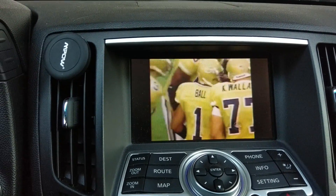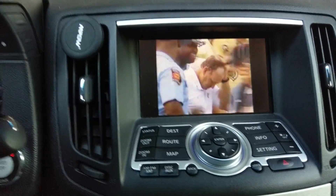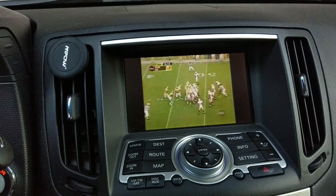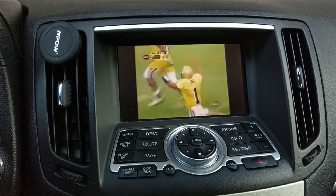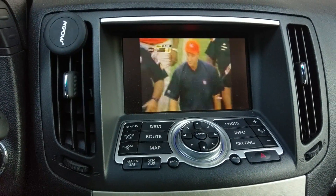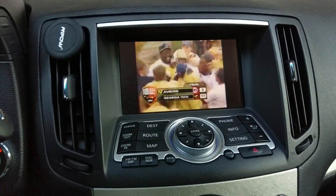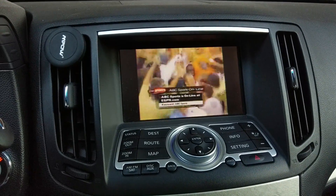A little bit about how to set it up: you need to use the hotspot on your phone since the Chromecast needs Wi-Fi. You'll need a third device like a laptop for the initial setup only. Turn on your Wi-Fi hotspot, connect the laptop to that hotspot, go into the Chromecast setup mode from the laptop, and tell the Chromecast to set itself up on your phone's hotspot. Once you do that, you don't need the laptop anymore — you've got a Wi-Fi network your Chromecast can use.